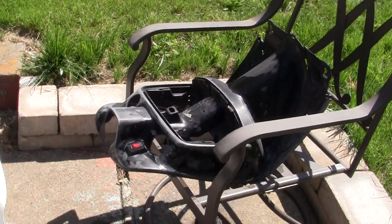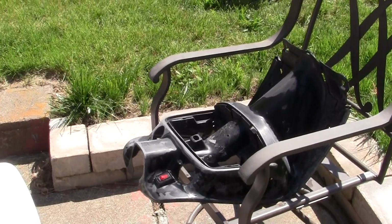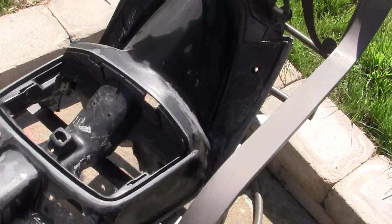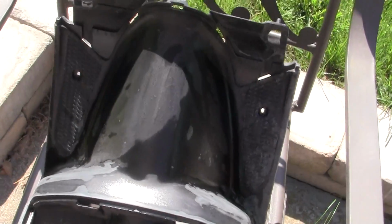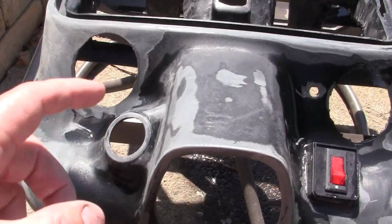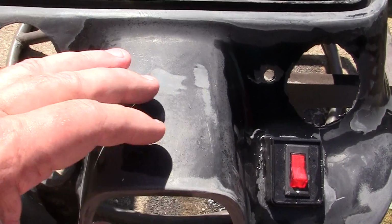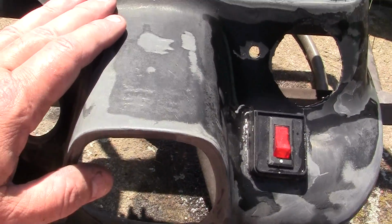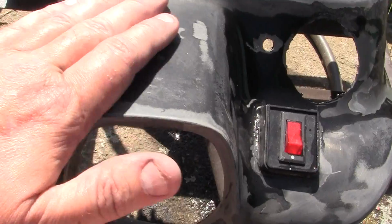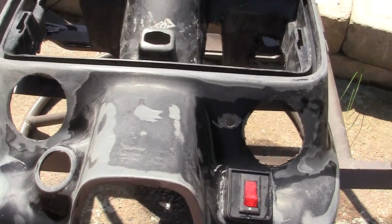Now on this last panel that I'm doing with truck bed or bumper black painting, it doesn't have to be perfect, but it does take a lot of time to sand everything smooth. And if you can take your fingers, actually this is an auto body lesson, you take your whole hand and you run it across here lightly. If you can feel anything, you're gonna see it in the paint.